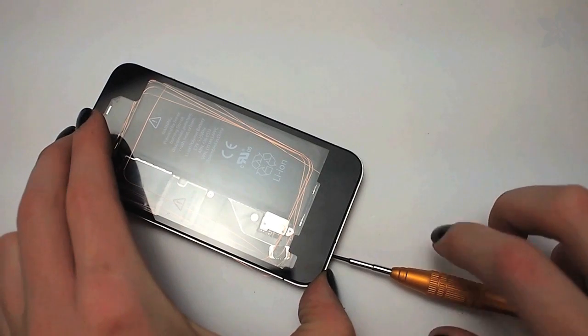It's really easy to change the back plate on your iPhone 4 or 4S, and today I'm going to show you how. There are two screws on the bottom of the phone — just unscrew those. They're either Phillips or Pentalobe. Then slide the back plate up and tilt it off.